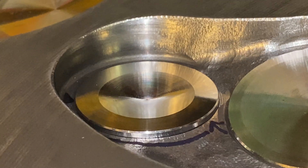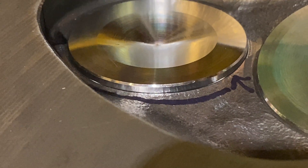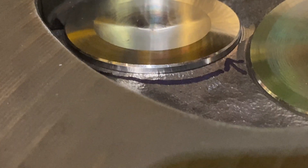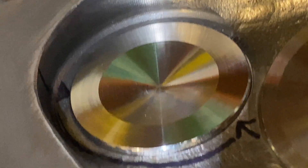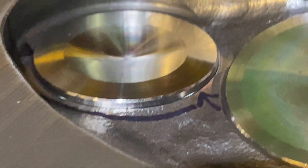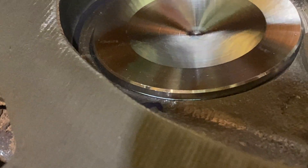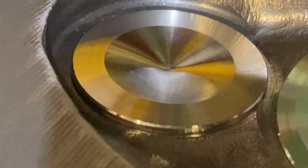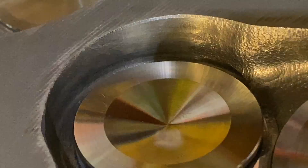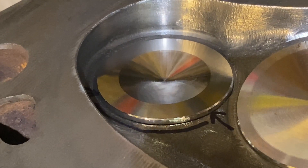Here's where I'm going to show you how bad this valve job is. If I stick a light up in the port, you can see light shining through — from arrow to arrow. You can almost see it flashing on the side walls. This is why you always check everything. That one's even worse than the arrows I put on there. This one I thought was okay — and this one is still bad. So I gotta bust out the valve grinding gear and fix up this head.